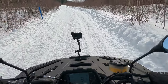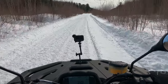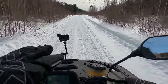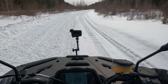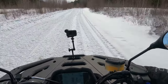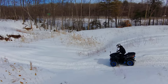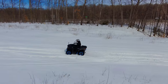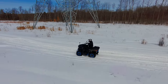I don't like their linked brake setup by the way — it's 70% to the front and 30% to the rear, and reversed for the rear brake. That's pretty much how linked brakes work on ATVs. But there's something weird: if I press the rear brake and touch the front brake, it's sending pressure to the top and I can't use the front brake simultaneously. That's something you don't get on Polaris or Can-Am products. The rear brake is way too sensitive — I just touched it and the rear locks up. There's some improvement to be made on the linking system.